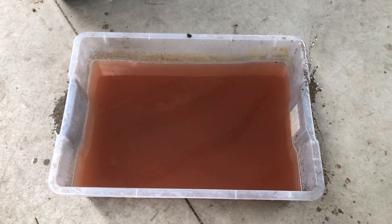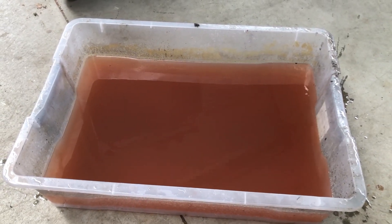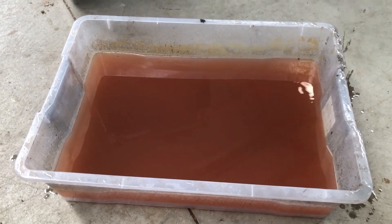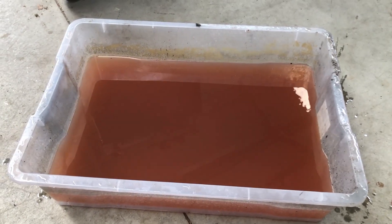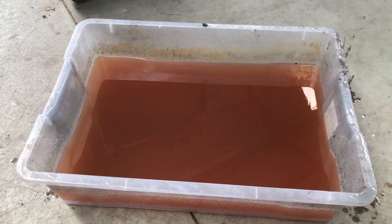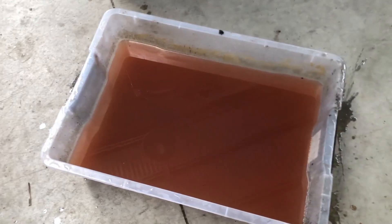This is the colour of the water that's come out of the engine on the third flush of the cooling system. Originally I used rainwater because it's soft, and an alkali radiator flush — I didn't film the results of that, much darker colour than this. Then a second flush of just pure rainwater. This is the third one. I think this colour is mostly orange from the coolant I had in originally, but it's a good sign that some of this is rust that's been dissolved and I'm very glad it's out.